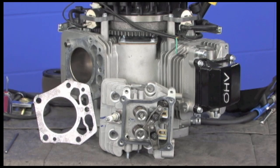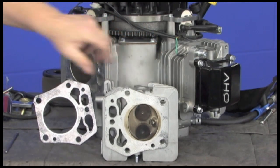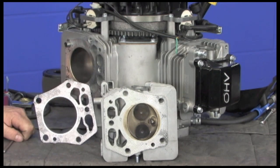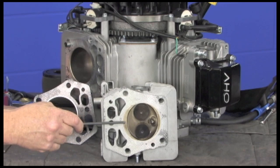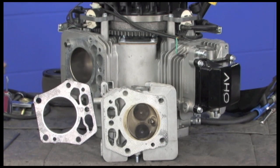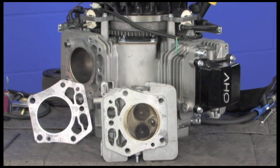Now let's talk about the cylinder heads. We use a cast aluminum valve cover for enhanced sealing between the valve cover and the head to reduce the chance of oil leaks in this area. It has the standard valve configuration of an overhead valve but the combustion chamber is designed at an angle. The valve train is also at an angle and the spark plug is at the start of the combustion zone, tapering out from there. When the plug fires on the compression stroke, just before the cylinder reaches top dead center, it gets the maximum downforce and thrust on the piston. Please note we have 5 bolts securing the head to the engine block — others use 4. The cylinder has a cast iron sleeve insert and the gasket has a much larger surface area. The 5-bolt attachment and the wider gasket reduce the likelihood of blowing head gaskets leading to more catastrophic engine failures.